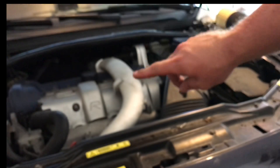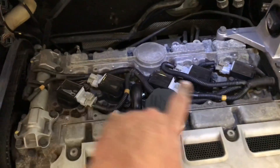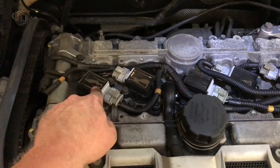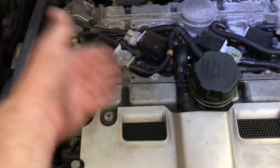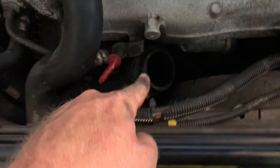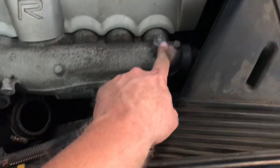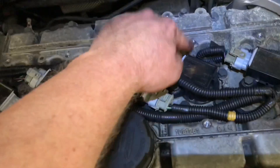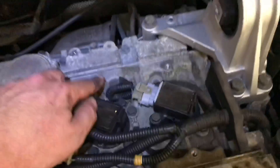We're now where we should have been a couple of weeks ago. We have each coil pack right here. What we're going to do is unclip the harnesses, take the coil out, then take the spark out, compare the coils and sparks old versus new, put everything back together and we should be good. I also took the charge pipe completely off — because it's metal and not very malleable, when you undo the bolts the pipe barely moves enough to access the Torx screw, which is a T30, for the engine covers.